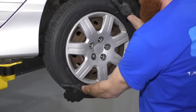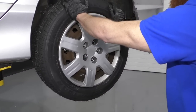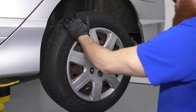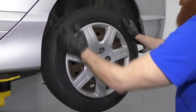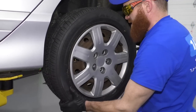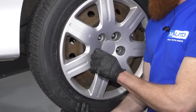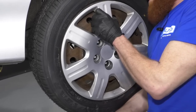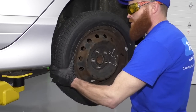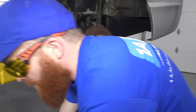Now I can hold the wheel firmly with two hands and shake it around — it doesn't really move too much. You might need to give it a little bonk. Don't use your hands; if needed, use a rubber mallet on the backside of the wheel. Once broken free, hold it secure against the vehicle, remove the last lug nut, remove the hub cap, and place those safely aside. Now use two hands to remove the rear wheel and roll it securely out of the way.